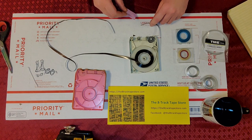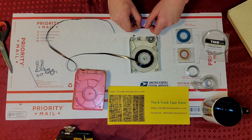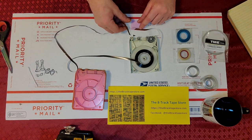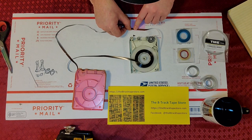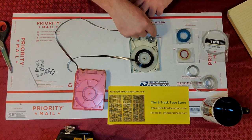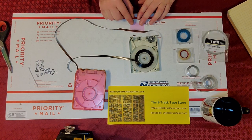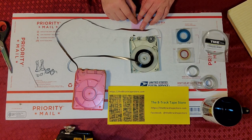The second thing — I didn't emphasize this enough, but it's important. When you are overlapping your tape for a splice change, the left side goes down first, and the right side is the tape that's going to overlap the left side by just about a quarter of an inch. That's important because the tape will travel through the spool in one direction, and the back will encounter various obstacles as it goes through the routing mechanisms inside the cartridge. So you want it to be left side down first, right side slightly overlapping.